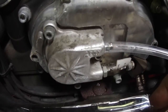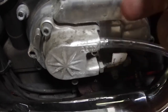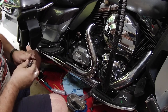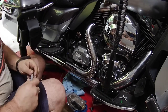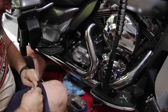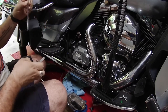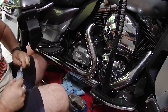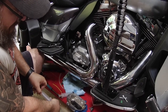You want to make sure this is a fairly snug fit. This is the same hose I use for brake bleeding, but this nipple is a lot smaller than your brake nipple. So I ended up having to get a second piece of hose that was smaller diameter — I got lucky and it fit inside the one I used for the brake lines, making a nice perfect snug fit on the fitting itself. Because you're going to be pushing this fluid through with a little bit of pressure, you want to make sure it doesn't squirt all over the place and make a mess.